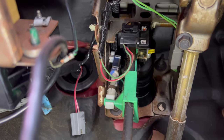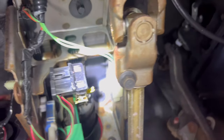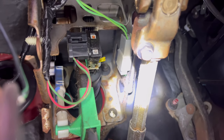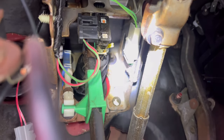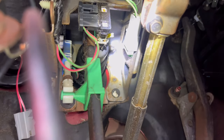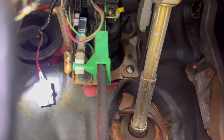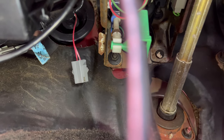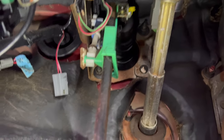Hopefully, when I get all this installed — see how it's got that little plug in there, it's got like a jumper — on the clutch assembly there's a plug that will plug into there. It's two black wires. Basically it makes a ground, makes contact, so that when this makes contact as well as the clutch pedal wires make contact, that's what enables the vehicle to start. That's better than jumping two wires, which would be your white and pink and red and blue on the harness under the hood, and still have it all function as it should have in the factory.